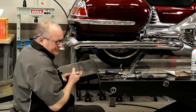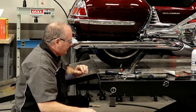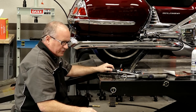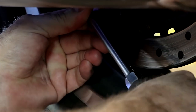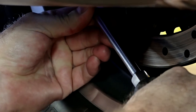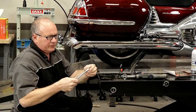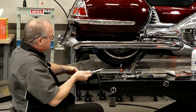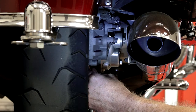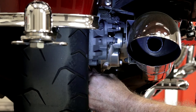First thing we need to do is go ahead and collapse the caliper. You can do this just by pushing in on it. I usually take a screwdriver and just gently pry in between the actual rotor and the brake pads, because I'm not going to be reusing the brake pads so it doesn't hurt to scratch them up a little bit. You do not want to scratch up the rotor itself, so be careful and don't let it dig into the rotor. You'll feel it when it bottoms out — when it does, just hold it for a few seconds and then release.